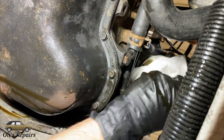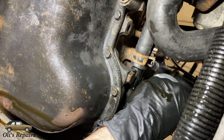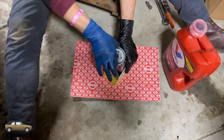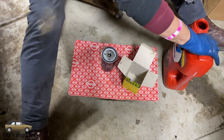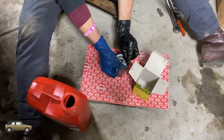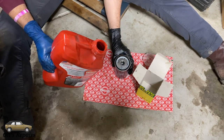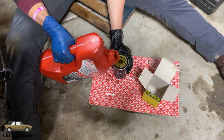Make sure to clean the oil filter mating surface and make sure there is no gasket still stuck on there or anything weird going on. The next step is to take the new oil filter, oil the gasket, and fill up the oil filter with oil. Oil will flow into the filter through the four small holes around the center large hole that it is screwed into.